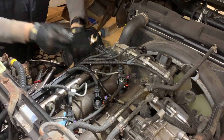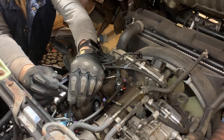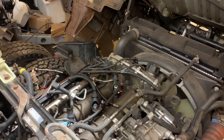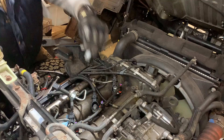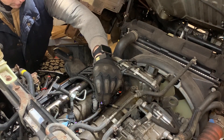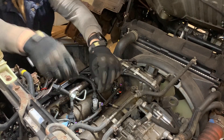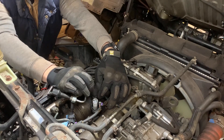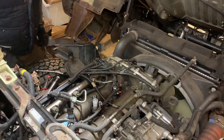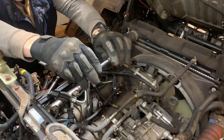I'm going to throw a bolt in here just to protect the end of the fuel line, and grab two caps — a cap on the injector main line and a cap on the return line. I also need to pop the electrical connection off, which you need to push down on this tab here and then pull the connector back. Then we need to remove the injector hold down clamp, which is 13mm.